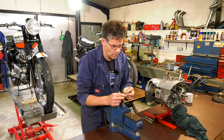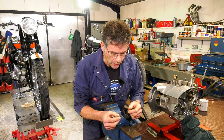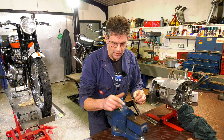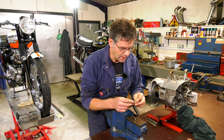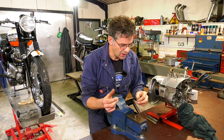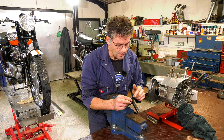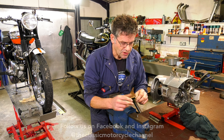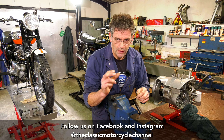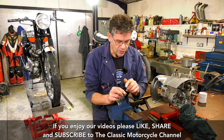We're just checking the pilot jet. Now this is quite a small jet — this is the one that will block most easily. You'll find when you try and start a bike, you'll tickle the carburetor, give it lots of choke, and it will fire up. But as soon as you take it off choke, it won't pick up. You'll find that your revs won't pick up and you'll probably adjust your pilot jet adjuster and get no response — because this controls your lower rev range. This controls it until it picks up on the main slide. So when you open up the throttle, lift the slide, the needle comes up, then you start to draw fuel into the venturi on your main needle. But your slow running is all through this little jet — it's all metered through here. It's a very tiny bore, so we make sure it is clear.